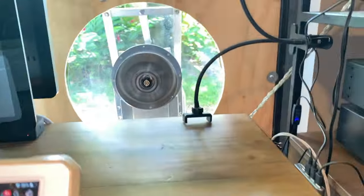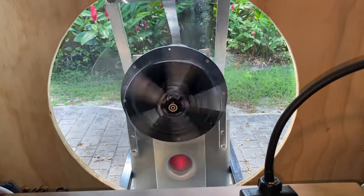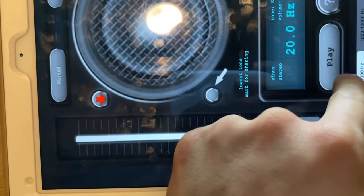So we've got this stuff to cover the higher frequencies. This one's gonna take everything 15Hz and below. Let's play some test frequencies, starting at 10 Hertz. I'm gonna set the crossover to 20 Hertz — it's not gonna play it. So we got 20 Hertz and it's not spinning. I want to show you that at these higher frequencies the motor structure of the subwoofer is actually attenuating — the blades cannot pitch fast enough to make a full movement and catch enough air while spinning to actually replicate the frequency that is playing.